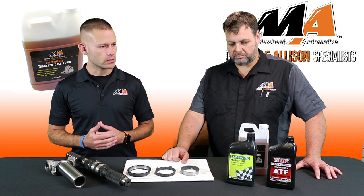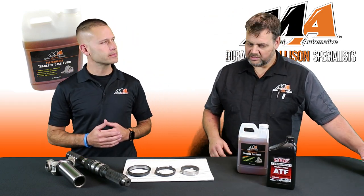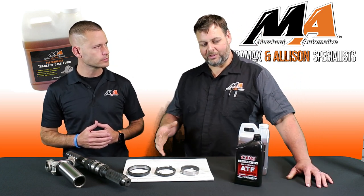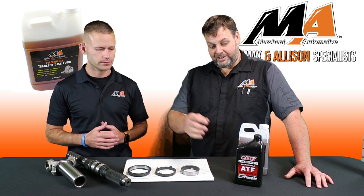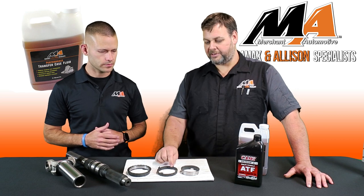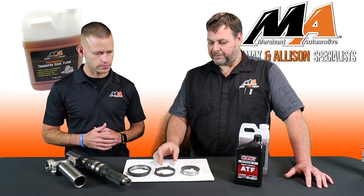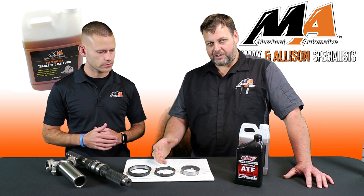Okay. So others are running some ATF fluid. What are your thoughts on that? ATF is actually the factory recommendation fill for a lot of transfer cases out there. ATF does have the properties to deal with the friction material because it's similar to an automatic transmission. We need those types of additives that are going to handle that. ATF is also a good lubricant. It takes care of a lot of issues.